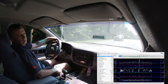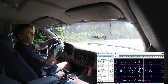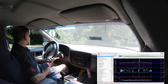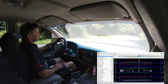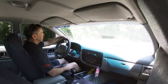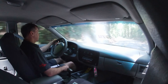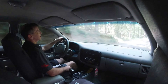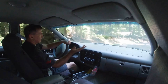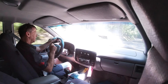Engine temperature is 185 after that. He does not have an electric water pump — he has a mechanical water pump. An electric water pump keeps it cooler at low RPMs, while a mechanical water pump works better at high RPMs. It's better for a road race car, the mechanical water pump. But an electric water pump is great for a drag race car and putzing around town — because at idle and low RPMs, that thing's running 50 gallons per minute, while the mechanical pump is running pretty slow at that point.